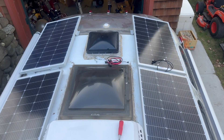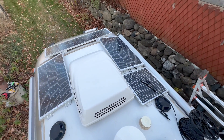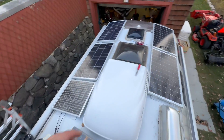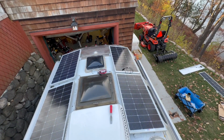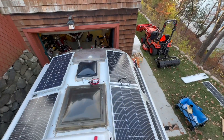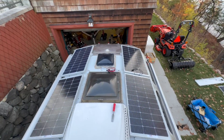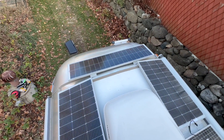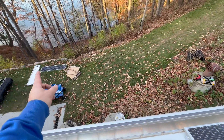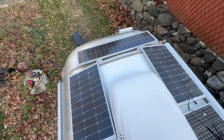We're getting the panels laid out here and I think we settled on a solution. We're getting as creative as we've ever gotten on an Airstream before. Quick review: we've got 100 watts there, 100, 100, 100 — for 400 watts back here. As you can see, we're dangling them off the back there a little bit. We offset one of the mounts there a little bit, and that should work fine. The other one is attached on the back corner, and we're using two fifties here. Probably where we're getting the most creative is putting a 100 right there. You might think, why not use one of those? But those are 90-watt and they run at a little different voltage than the other hundreds. I had one of these and they match a little bit better, so we're going to go with that.